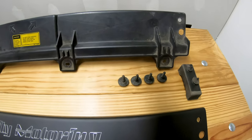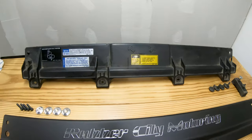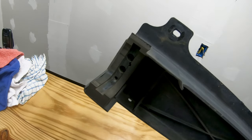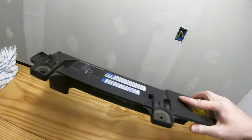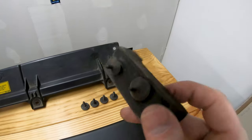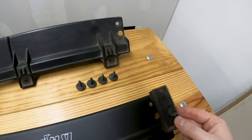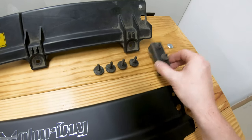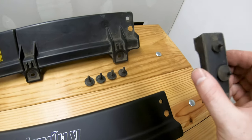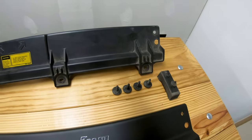Four 10 millimeter bolts come out of the stocker and it lifts right off. My biggest worry was these rubber isolators that hold the radiator right there. I already got one out — I was worried it would break but it just comes right out. To reinstall you might want to put some WD-40 on there so it just pops right into those holes. There are two of them and they appear to be side specific — there's actually a part number on them if you can see that, so you can get new ones if you wanted to.